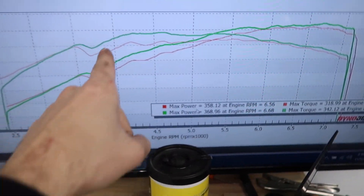Just by getting the fuel adjusted, the car was running rich before. Same boost, same everything — I pulled a little bit more fuel out. My first judgment was pretty close. If you were tuning online and you had a correct MAF curve with the right setup, you would not have this problem. But the cars here are not meant to run with that charge pipe setup, right? It's going to get a little bit more consistent.